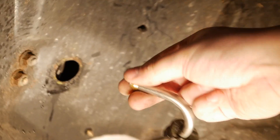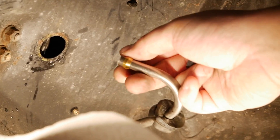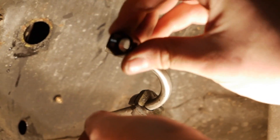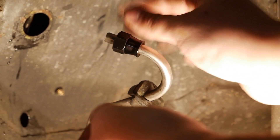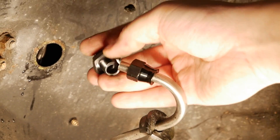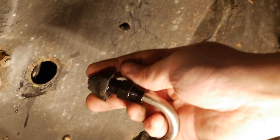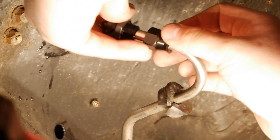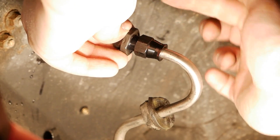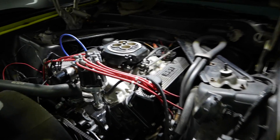We just cut the barb off this little guy right here. Michael got it nice and clean with the pipe cutter. Now we got the special AEM fitting here that's got this ferrule, and you get this fitting right here. Give her the old stick-on, put this on like that, and then goes this piece, and then they just screw together and pinch that down. One nice thing is to make this flush - you put it in here like that and then screw onto this. You're holding this into the line and you're screwing this onto the line.